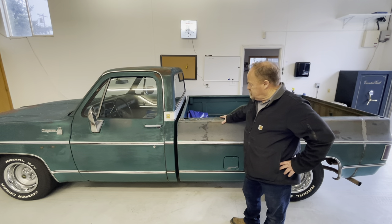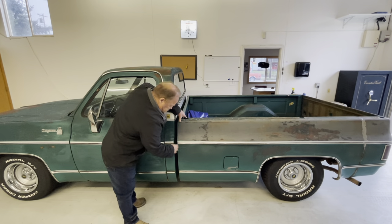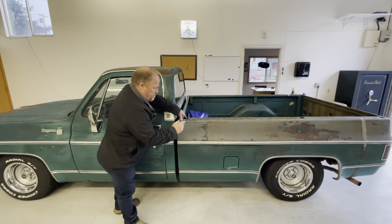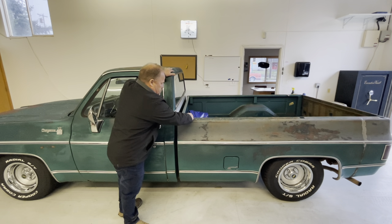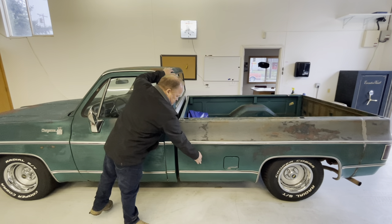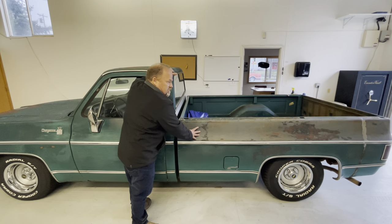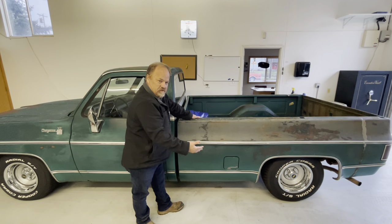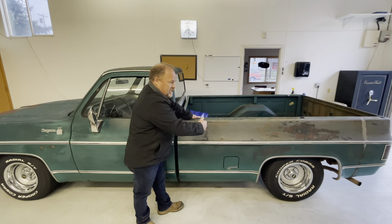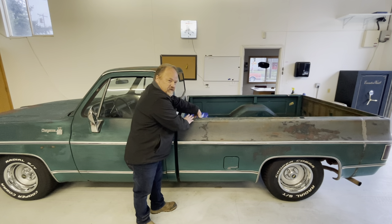On our next video, you'll see when we cut the 14 inches out of here. We're going to cut up here as close to the front as possible, all the way down — a straight line like what we did on the back — then come up here and go across to save our stake pocket. We're also going to cut 14 inches back here, but we're going to treat it as two separate cuts. We'll do the outer shell, cut it off, drill our ribs out, pull the outer shell off, and then cut the inner section, bring it back, and butt weld it together down there. That'll make it easier and help us save the stake pocket.